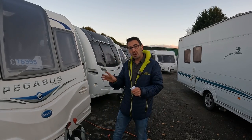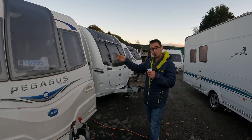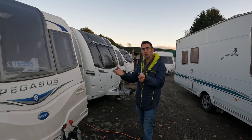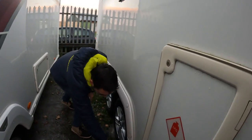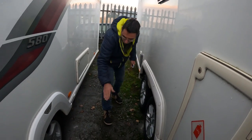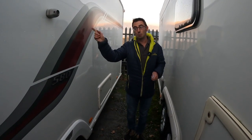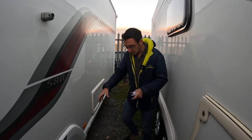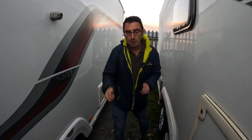When putting the caravan into storage and removing the handbrake, allow a little bit of room so the caravan can still go backwards — a foot or so. Then we want to chock the wheels. You can use proper chocks that go at the front and back of the wheel, whether it's a twin axle or single axle. Put a chock at the front and a chock at the back of the wheel, then release the handbrake — and do that both sides. Even if you don't want to buy proper chocks, a couple of big bricks in front and behind the wheels on both sides will do.